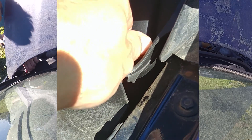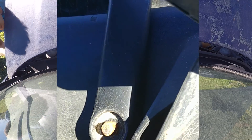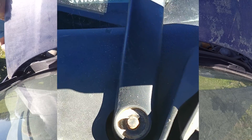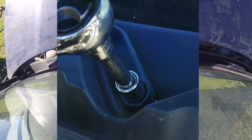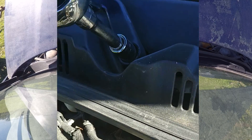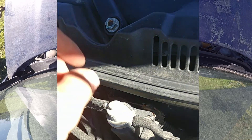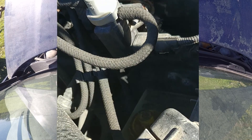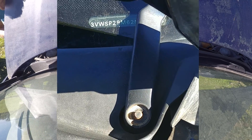It's usually good practice to leave the nut kind of flush on the end of the shaft if you're going to have to use a puller, but because there's very little thread to work with on this one you can't really do that. Looking at it, it's rather rusty so I'm sure we're going to have fun on that one. At least this one doesn't look quite as bad and it undid a little easier. I haven't decided whether I'm going to swap these arms altogether - someone got blue overspray all over them so they don't look very good. That one's got some rust too but we'll try the puller and see how things go.